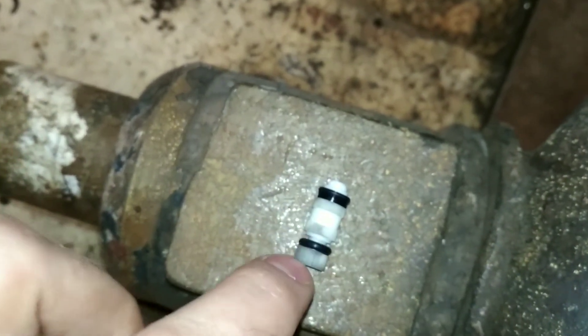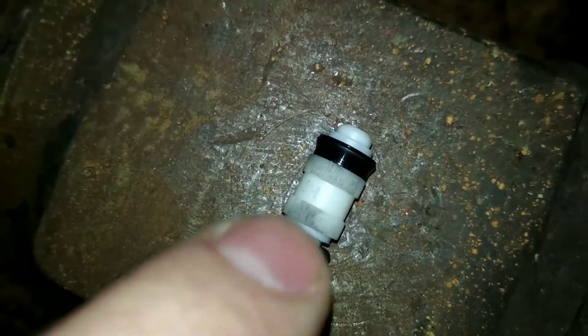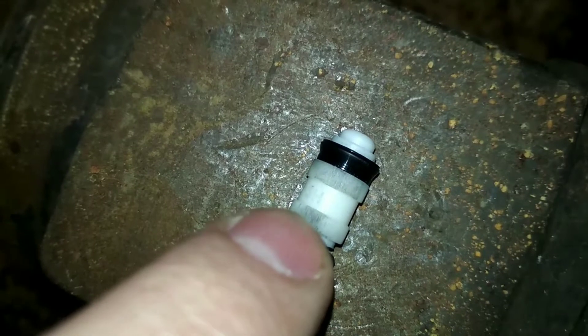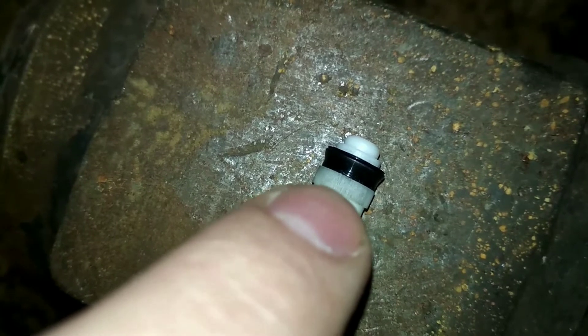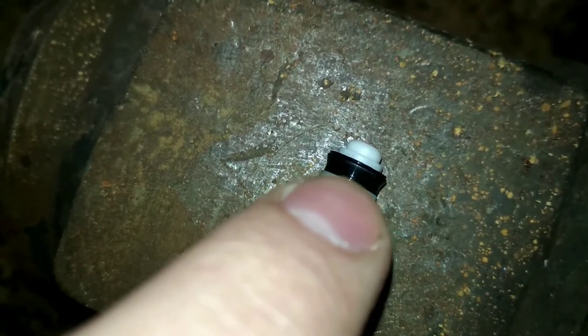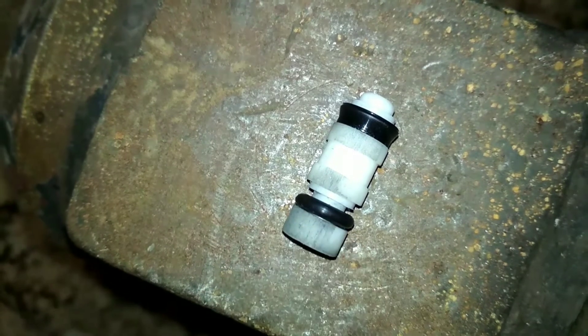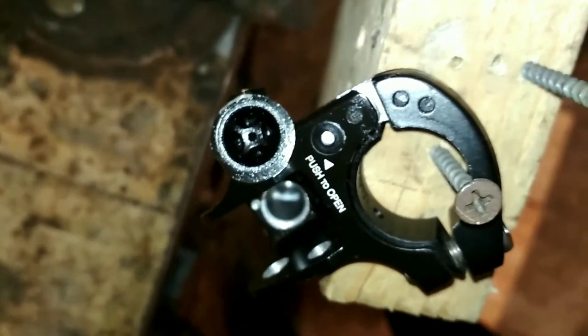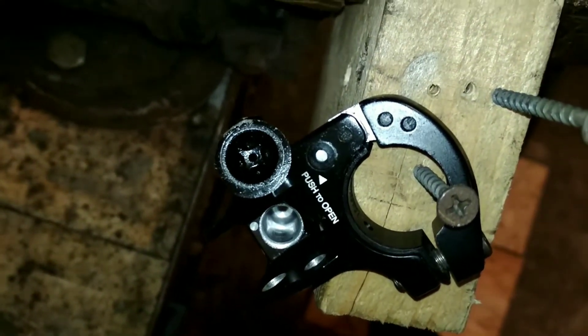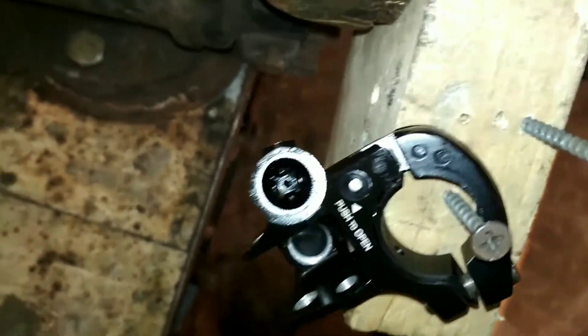The problem is growing — the contamination is moving further and the scuffs are moving with it. With those protruding bits, you have the first plane touching the cylinder wall, then the second and third planes, then the piston gets narrower so nothing touches there. Unfortunately this plane is enough to scuff the surface under that seal as well. Maybe the seals don't get damaged — that's not the original seal, that's an o-ring I bought. I will try to even out the surface with wet sandpaper, which may improve things and prolong the life of the levers, but it's not certain.